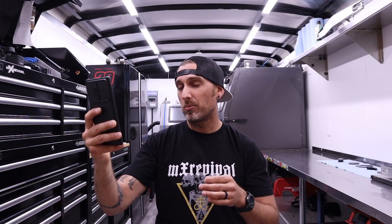That was really cool. Works with stock throttle cable. May have to remove cable lock nut to get desired free play. I didn't have to do that. All metric hardware, this is also true. The top of the new Billetron had 3mm Allen head bolts in it, just like the Keihin that I took out of it. So literally I just used my one tool and popped the top off the stock one, popped the slide off, popped the cable into the new Billetron slide, dropped it in, used the same tool. So there's Japanese style hardware in it. That was really handy.